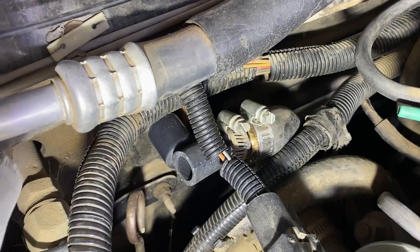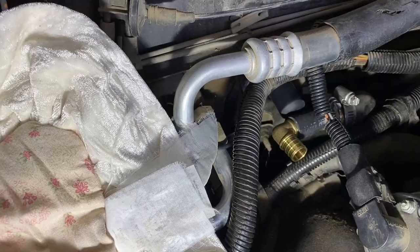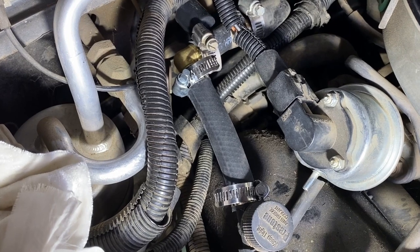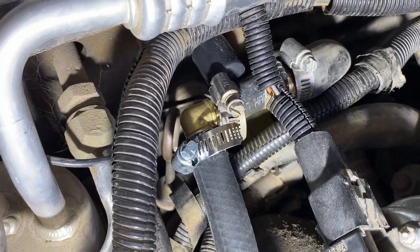Rubber caps have been installed over the heater core tubes, along with the reducing coupler. Next, the 90 degree elbow. The existing 5/8 diameter heater hose to the 90 degree elbow is the final connection.